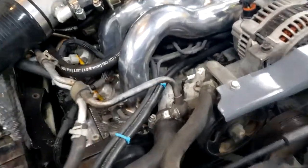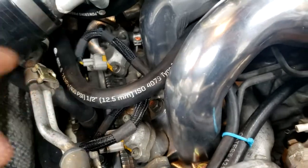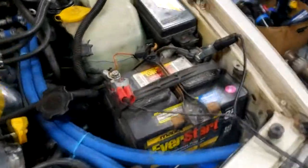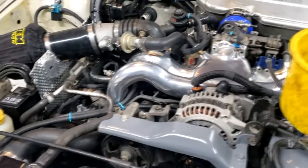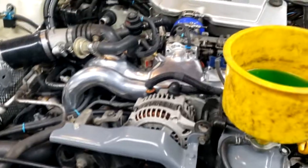I found that I had the injector connectors swapped on each bank. I still think it should have tried to fire, so I'm not really sure. But we did confirm that the coils are getting spark — at least the cylinder 1 coil is. So yeah, I'm going to try and crank it again.